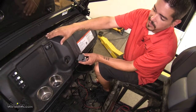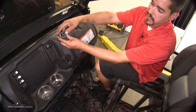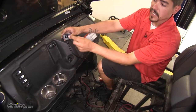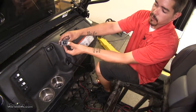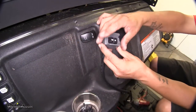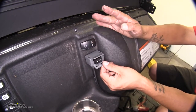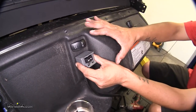To make our application look a little bit nicer, we're going to pick up one of these momentary switches — the same kind of momentary switch as included but in a different style. We're actually going to be cutting the wires off our switch and rewiring a new switch. We carry a full line of switches on our website — just make sure you find one that is a momentary switch with an off and an on, or in and out. If you don't feel comfortable cutting your switch and rewiring a new one, you can cut a hole in the dash and attach the original switch there instead.